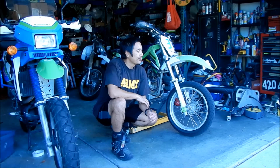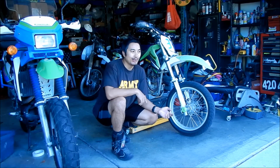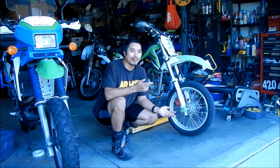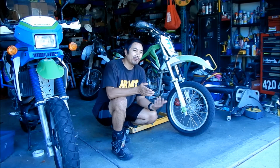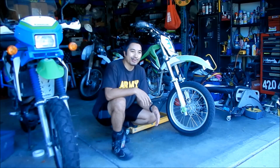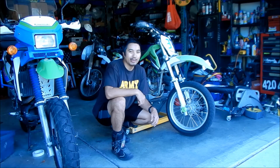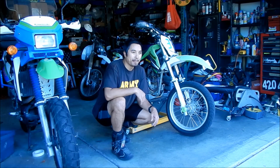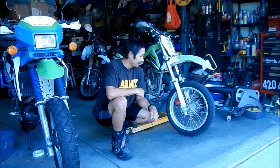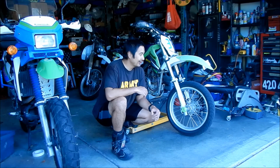Alright, here's Mick here. So that was it. That was the first startup and the break-in video. You saw it took like an hour to break in, and then we checked the compression, and we checked the spark plug, checked the oil. Pretty much everything checks out. Nothing looks like it shouldn't. There's no shavings in the oil or anything yet. So I think we can still run that. We'll run that for a while. After the race, we'll change it. So that's pretty much the end of the KLX140 big bore top end rebuild series.